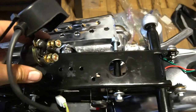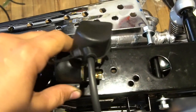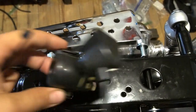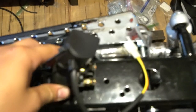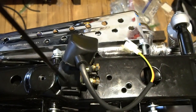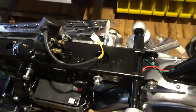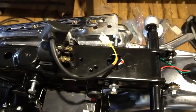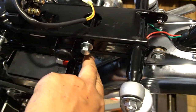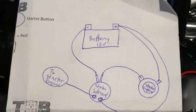I'm going to pre-mount my solenoid and then work on the wiring for that. I'll use these two rubber shield holder mounts for the solenoid — just run a big zip tie down, through, and up to hold it in place. The seat should have enough clearance once bolted to have that sitting under there. I'm not going to shove everything in behind here — I'll save that space for the rectifier, CDI, and the extra sub-harness.